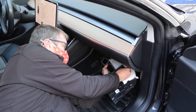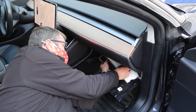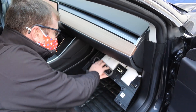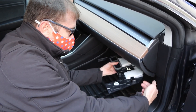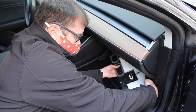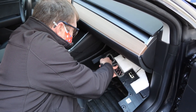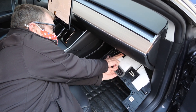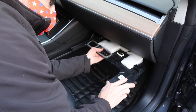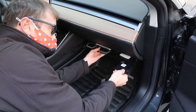Plug the light back in and you'll hear it click, and obviously it comes on. When putting this panel back up, one thing I missed the first time is there's a piece up here that catches the insulation on both sides. You have to slide this up and then slide them onto those pieces to keep it up, then put the pins back in.